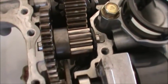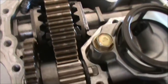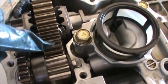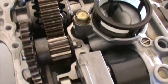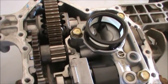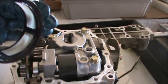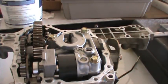Here's a close-up look inside — there is a lot of metal. The magnet back here is covered in metal particles, and there's a lot of metal on the bottom too. Looking at this main gear I can see a mark in the middle — it was probably aluminum because no teeth are broken. After looking around and doing a little research, this is the filter — this part will be replaced. You can see it has some particles in it, so I'm going to buy a new filter.